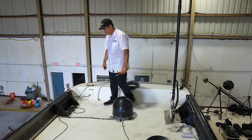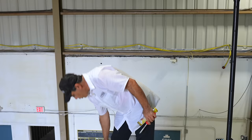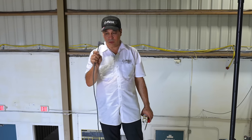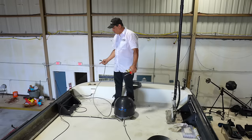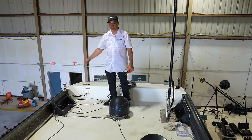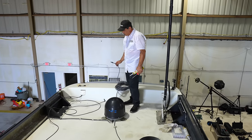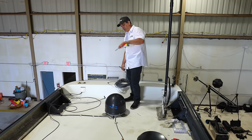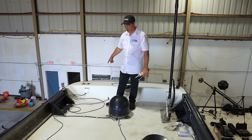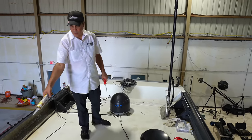One of the hardest things in these coaches is getting these wires down through the cap, through some of the beams, and into the electronics panel. We have to do it two different ways because the WiFi unit wire has to snake one way. We'll use the existing wires from the DirecTV and tie them up inside there, pull one out and pull it through that way. But on the new high performance unit, you've got this big cable that's going to be hard to pull through, so on that wire we're going to pull it down the other way.